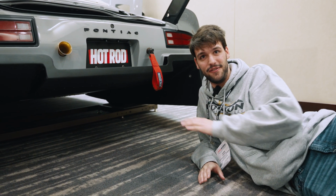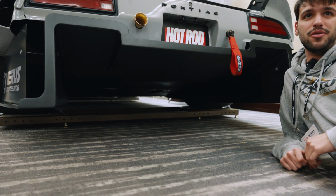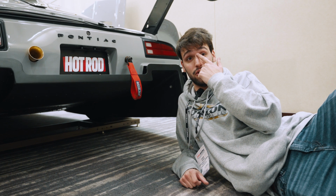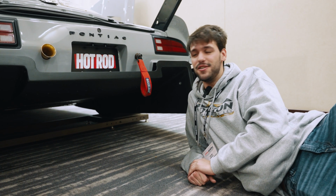If you go underneath, if you're able to, you can see our exhaust dumps into it. That also allows us to do gear changes because we can just drop the exhaust out, and that will allow us to reach up and get to the gears a lot easier. But we still need to add the strakes. The strakes added more downforce on top of that.